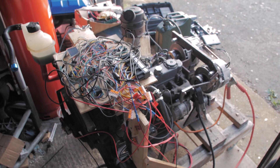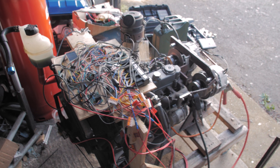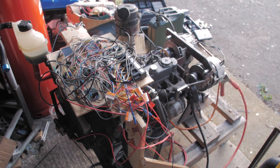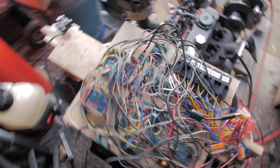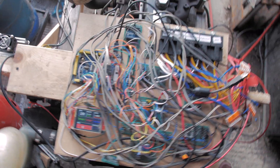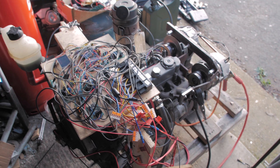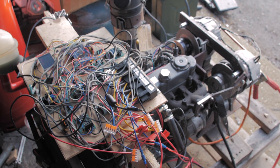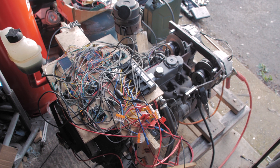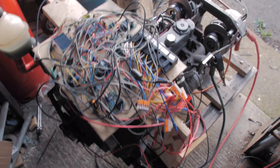There's a cooling cycle designed to heat up the engine as quickly as possible. It'll only run the pump for short bursts to begin with, up until about 50 degrees. When it reaches 50, it runs the pump at half speed. As it starts to approach the set coolant temperature — around 90 degrees — it runs a PID loop, which basically tries to reach the target temperature without going over it. If the temperature does go over the set limit, the cooling fan kicks in and cools it back down.